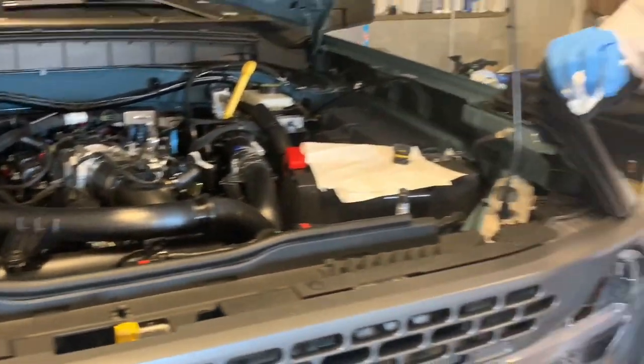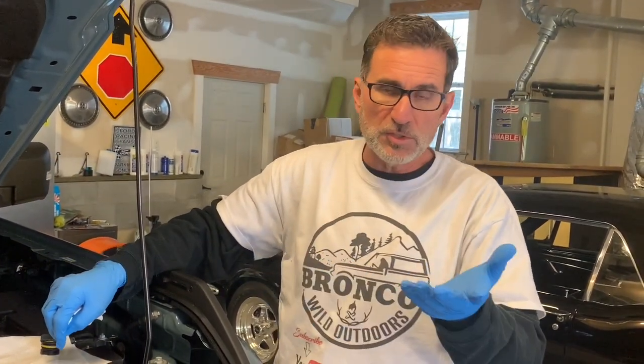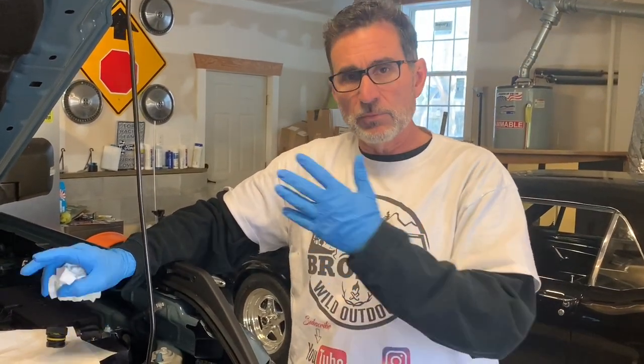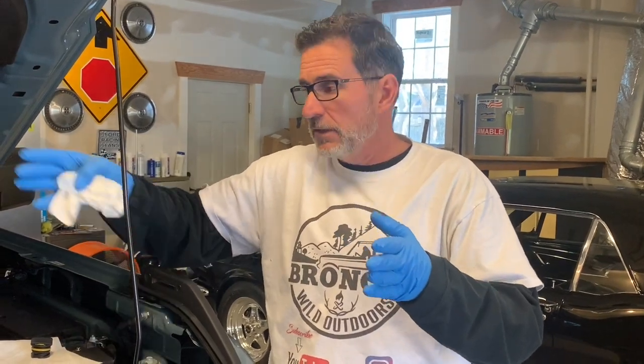The oil filter has a seal on the inside of it. That canister has oil on the outside of it. And when we take that off, it's going to drain some oil out. Now, how much oil drains out, I don't really know. Some people I've seen on the videos have taken it out with the plug out. Other people haven't. And so I'm concerned that maybe that's a quart of oil or some amount of oil. Remember the 6 to 7 quart discrepancy, I'm looking for it.